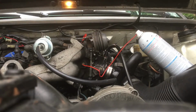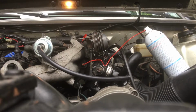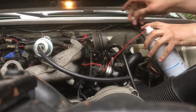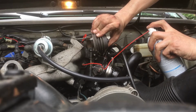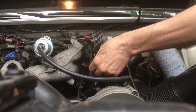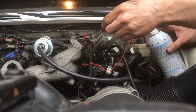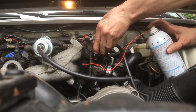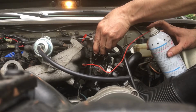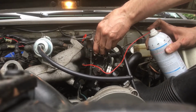This is the fuel pressure regulator. You don't really need it at idle too much. Got to go. Make sure that tube is not kinked. Yeah, you can tell it's getting rich when the engine really starts to shake. A little smoke.